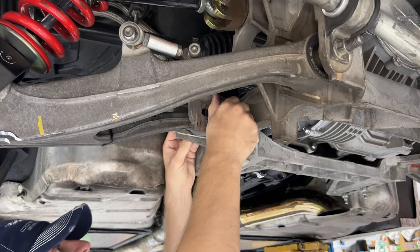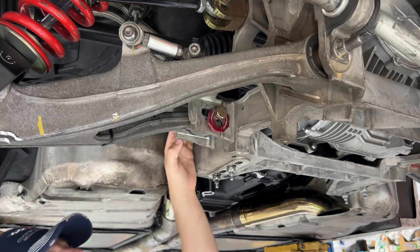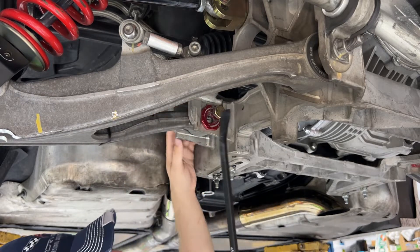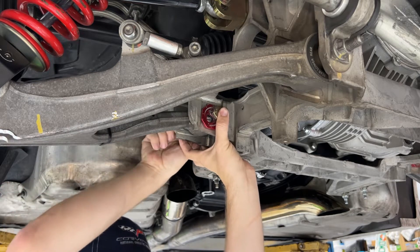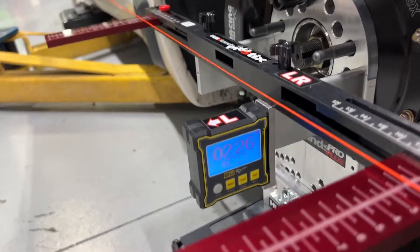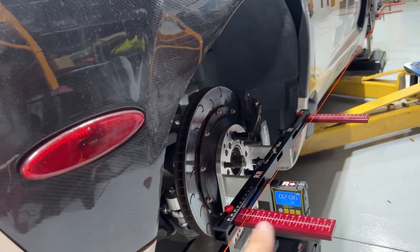Because we're not switching letters, we can just loosen the nut without taking it all the way off. The plate is in there pretty good, so use a screwdriver — and more so on the rear than the front, you will need a pry bar. We're going to move this to T4. You can see how that pushes the arm out. With the car back on the ground, we got 2.26 on this side and a little bit closer at 2.06 on the other. We cut that gap in half. I'm going to add one more turn here, going from S3 to S2.